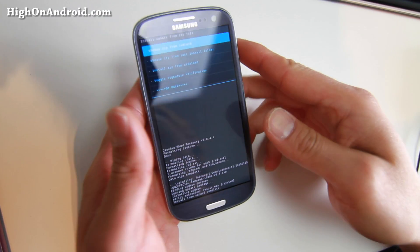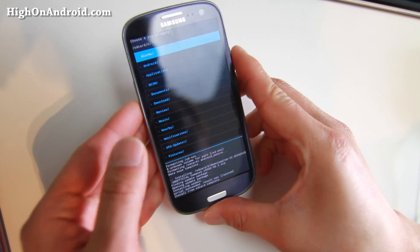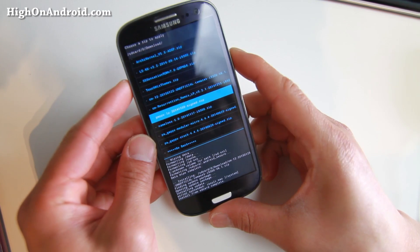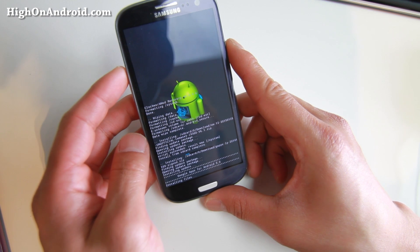Alright, it's finally done — that actually took about five minutes, which was the longest ever. Go ahead and install GApps now. Make sure you use Lollipop GApps. If you use KitKat GApps, it's not going to work.